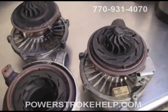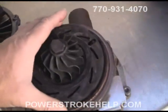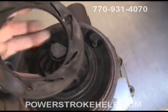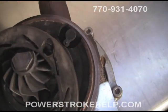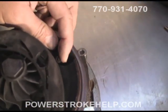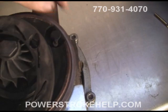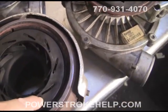What I want to demonstrate here is actually a mechanical failure of the VGT aspect of the turbo. As you can see in this one, it's basically worn out. The slot that the solenoid pin rides in is just plain worn out — it's broken. As a result, this turbocharger just wouldn't make any boost off idle. The VGT solenoid would actuate and move the full distance, but the ring wouldn't move because the slot had opened up so far, and as a result we weren't getting any boost off idle.